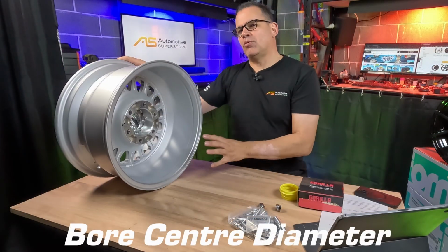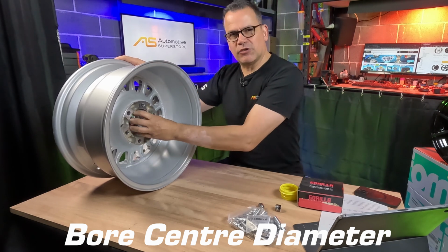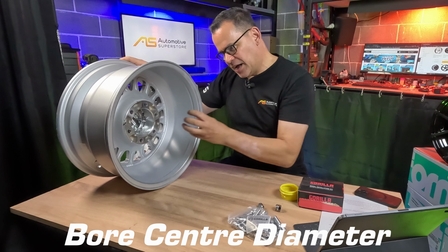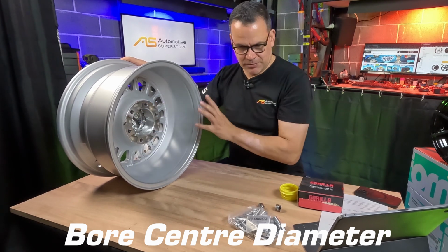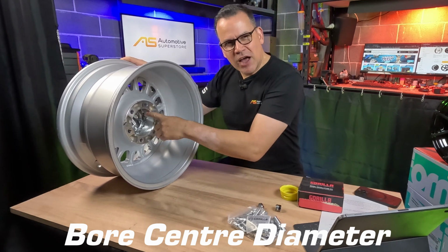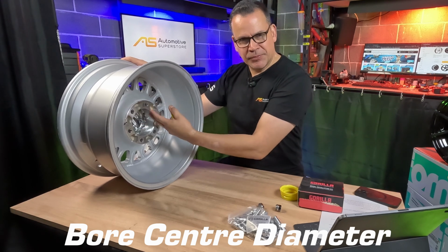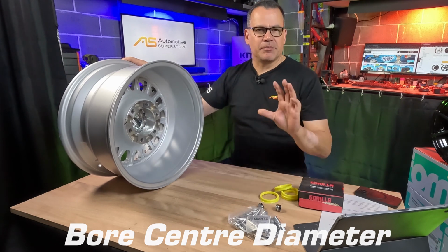The next up is bore center diameter. That's the bore here inside the wheel. It locates on the hub, and the entire weight of the vehicle is carried by this area here. It's important to make sure that the hub locates into this properly to carry that weight, and it's not carried by the wheel studs themselves. Now, it's not always the case that you're going to buy a wheel that's got the exact same sized bore hub center here as your hub. What the manufacturers tend to do is they make a wheel with a larger center, and then they'll provide you these locating rings that clip inside and make up the difference.